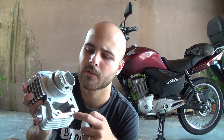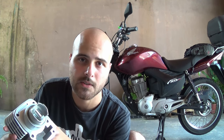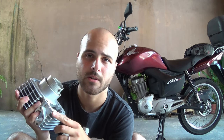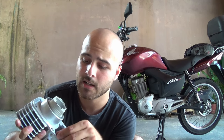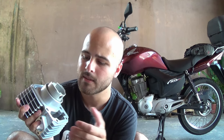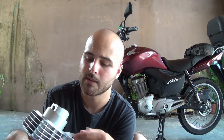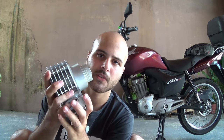All we're going to do today is the cylinder and piston swap. The most time-consuming part would be removing the old gasket from the bottom of the cylinder. This bike has 10 years of use — I got it with 49,000 km and it's now touching 60,000. Last week on a friend's identical bike, it took me a solid four hours to remove that gasket — a lot of sanding and working with a razor blade, because the paper gasket just mates to the metal surface completely. Unless you have a lathe, it'll take hours.